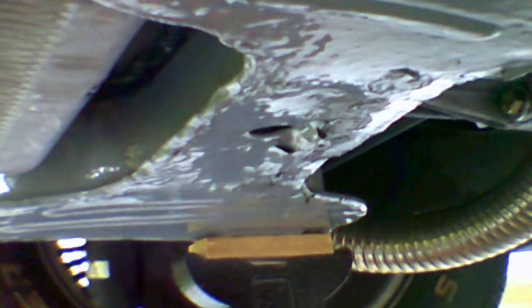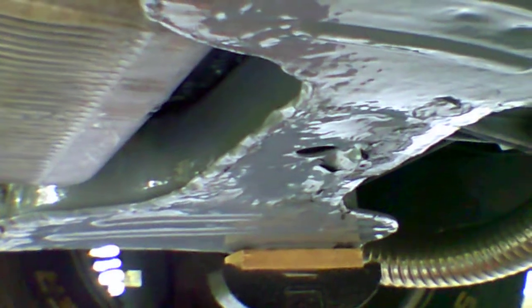I stripped all his engine cradle down. As I said in the other video, it got battle scarred underneath here from jacking it up. The paint hadn't gotten all the way hard — it takes about a month for the enamel to get hard. This is just plain old enamel, and it takes about a month for it to get all the way hard. So this started getting jacked up before it was ready. I'll clean it up and repaint it when we're totally finished with the jacking process.